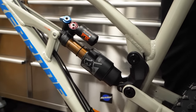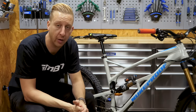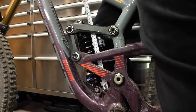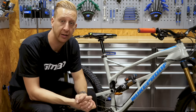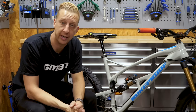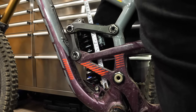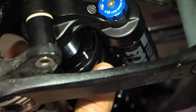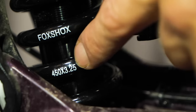If you're running slightly firm or slightly softer, simply repeat with the air shock until you get there. When measuring a coil shock it's a little different because you don't have access to the exposed shaft in the same way. The easiest way is to measure the distance between the two eyelets of the shock to get the total length, then work out a percentage of sag in relation to the amount of travel that shock has. Instead of looking at the O-ring, you measure the eye-to-eye distance as you sit on the bike and check you're within that 30 percent area. If you're not, on coil shocks you only have about two turns of the preload ring to adjust — any more than that and you'll need to change the spring rate to a heavier or lighter spring.